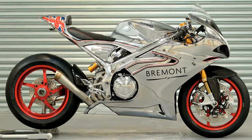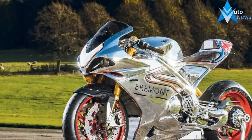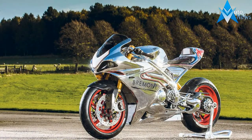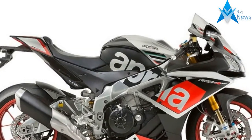Our engine bears almost no resemblance to the Aprilia — our engine is more compact than theirs, despite being 20% bigger in capacity. We could have run a 90 degree V, which would be about 3kg lighter because there's no need for a balance shaft. The Honda V4 doesn't need one because it has offset crank pins, but we couldn't do that and achieve the revs we wanted.